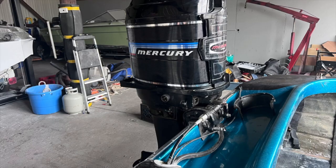So my lifelong friend Peter and I brought the engine down to Merc's on L6 in West Virginia to help make it talk. We have 125 pounds of compression in all 6 cylinders and spark. Our plan was to spend the day replacing the fuel lines, the fuel pump, rebuilding the carbs, setting the timing, and then doing the water pump.